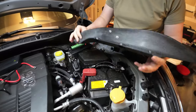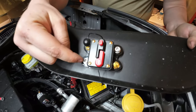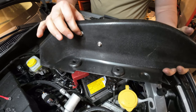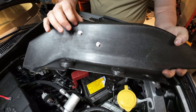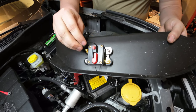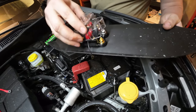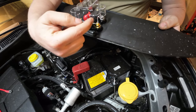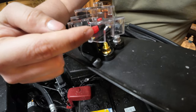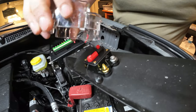Here's what it looks like when you mount the fuse. Mark a hole, install that bolt, then drill through to make the second hole in the perfect location. The bolts included weren't quite long enough — we used M6 bolts with washers to spread the force. Looking very good. The little terminal covers are probably unnecessary since they're covered by the plastic cover anyway. When you put the cover back on, the power wire needs to come out through a specific section, so we'll need to remove that section of plastic cover while leaving the little clippy leg.